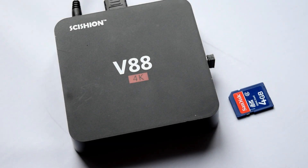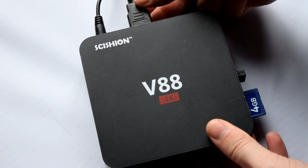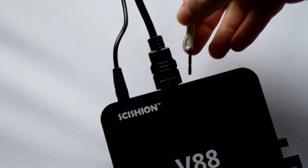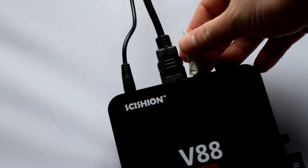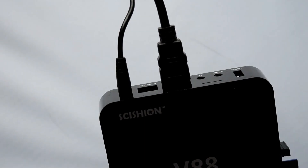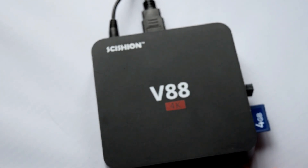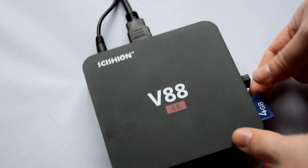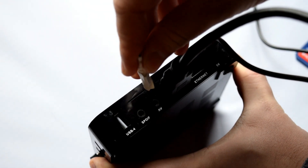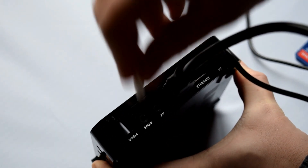Insert your SD card into your TV box. I'm going to insert mine into the V88. As far as I'm aware, it should just boot if it's going to work. However, you might find you have to insert something thin into the AV port or another location on your TV box — normally there's a reset button somewhere. That tells the hardware to look to external SD cards inserted in the box to boot from, if an operating system is present. Traditionally on these boxes it's found in the AV port, a tradition since the very first TV boxes were released back in 2010.